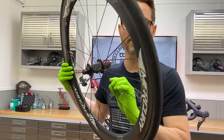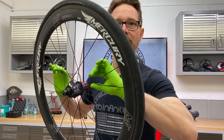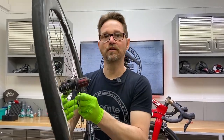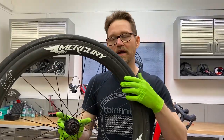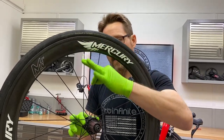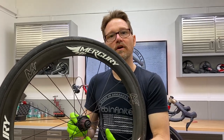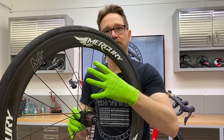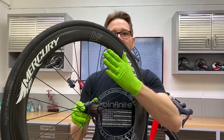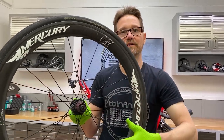Let's see if there's any creaks left in this one right here. You can hear those creaks. Hear that? Every time this wheel comes around — when you're going down the road, what's happening in the wheel dynamically? The hub is actually hanging in space, hanging off of the spokes. So the spokes down here are losing tension as these are in tension. As the wheel's coming around, they're coming into tension, tension, tension, full tension.